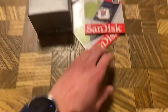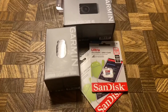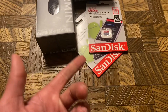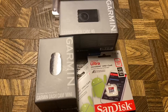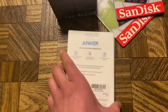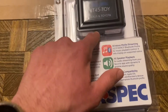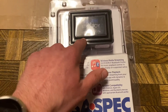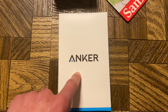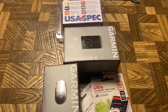The nice part about these cameras is that as they record more, they overlap the old video, so I'll never have to worry about manually deleting things. While these dashcams are great, they're nothing without power, so I bought this Anker four-port USB splitter, which hopefully will have enough power. I intend to plug that into the USB port behind the dashboard, run it into the glove box, and have two ports hooked up — one dashcam running to the back and one to the front.